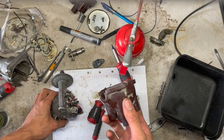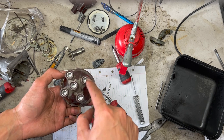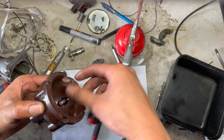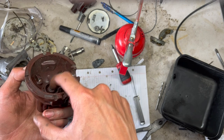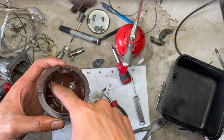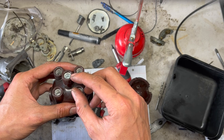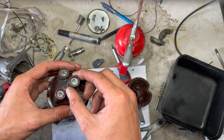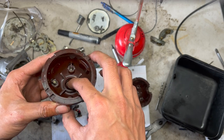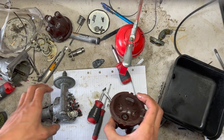Now for the cap. This is a secondhand cap but make sure there's no corrosion inside. I've already used a Dremel tool with a wire attachment and cleaned all the contacts out. Make sure the little graphite tip is spring-loaded and not seized. These points where the spark jumps to — make sure they're not corroded or dirty. This other cap I haven't cleaned yet — you can see a lot of white powdery stuff, which is aluminium oxidation, and inside it's all rusty and disgusting. That's why I've chosen to use the one I already cleaned up.